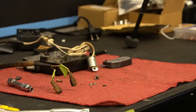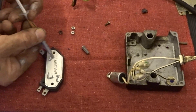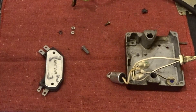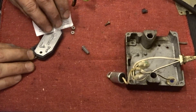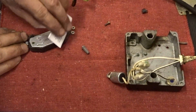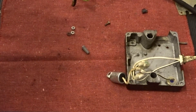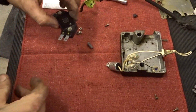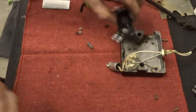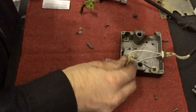I'm going to go ahead and use the silver paste. What I'm going to do is put a little bit out here on this little box, then use the straight edge of a paper sheet to very lightly smooth some of it on. As you can see, we've just got a little bit on there — that's all we need. The whole point is to make a little more direct contact and fill in some of those very small air pockets that would exist.